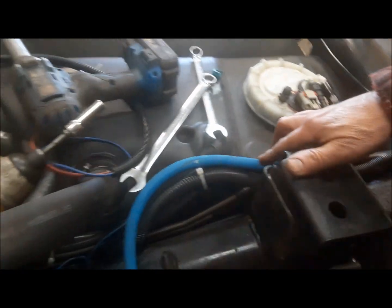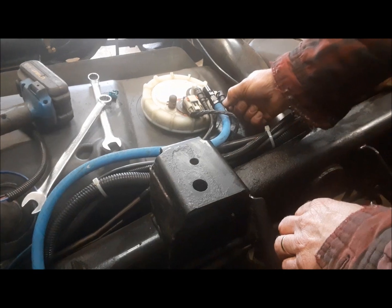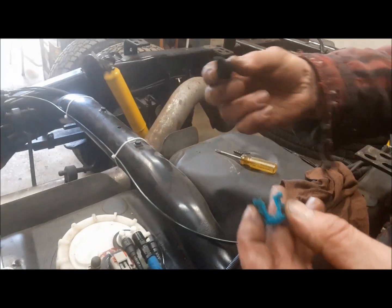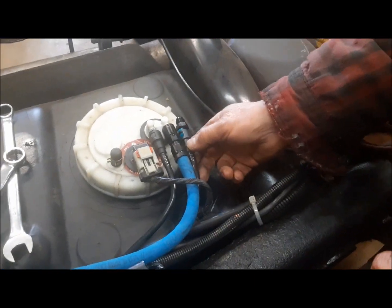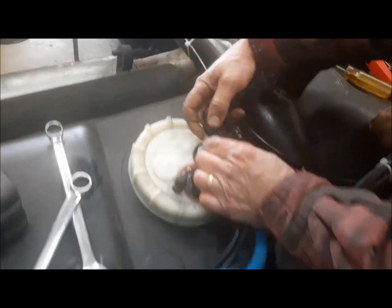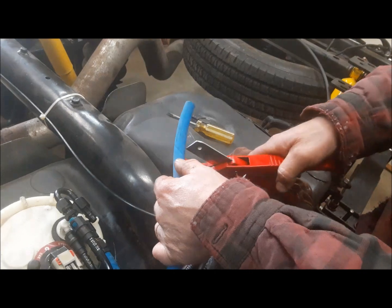So there's this one on. This is the one that the pump will pull the fuel out of. Then it's going to push it through the water separator, then through the filter, and then back out to — this is the line that goes back up to the front of the truck. So now we're going to hook that up. We have to convert our factory fuel line to AN, so we're going to put this guy in. We put our factory lock over it and then we just push it in. Here's our line that comes back out of the filters to the truck, and we've got this little 180-degree fitting. We've got to put that on there so we can figure out the length of our line, then we'll go back over to the bench and put it together.